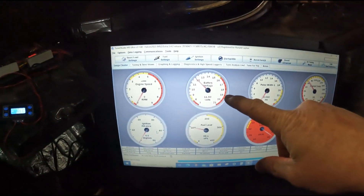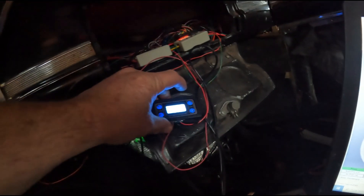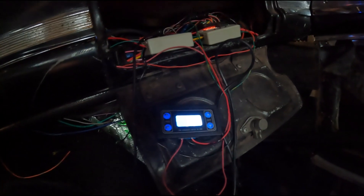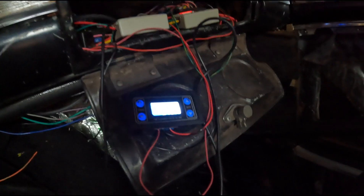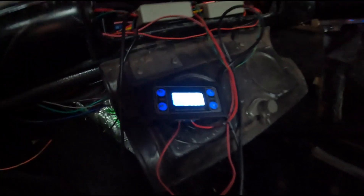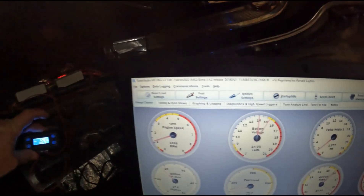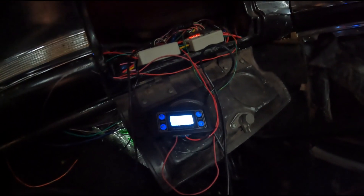I've got my laptop so we can watch the voltages once we start it. At 60% duty cycle, we're reading 13.2 volts. Let's pump it up to 70 — now at 75% duty cycle we're at 14.4 volts. She's working! So if you end up getting the wrong alternator like I did, or if your swap comes with a two-wire, you can grab this unit off eBay — look up 'LS1Tech LS swap' username — link is in the comments. There's 75% and there's 14.5 volts. If I lower it back to 67%, we're back down to 14.0 volts. The duty cycle clearly controls the output voltage.